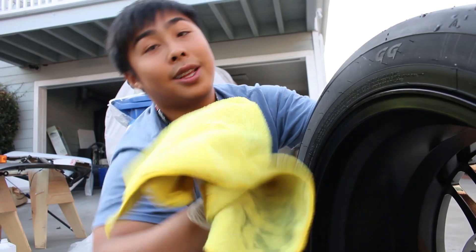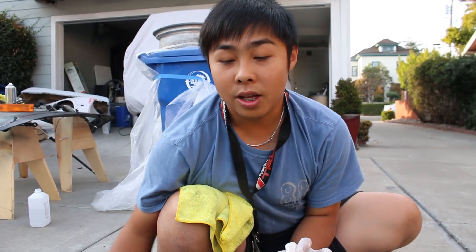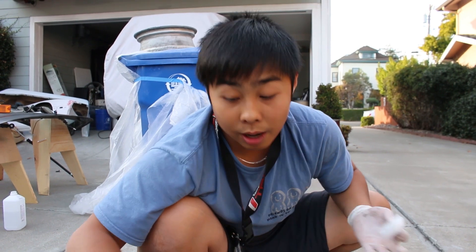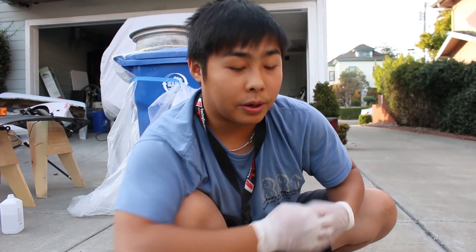The wheel is ceramic coated now, so don't get the wheels wet. I know it's tempting to immediately test how hydrophobic it is, but realistically you want to wait at least 24 hours. That's what I'm going to do — wait 24 hours before testing durability and hydrophobicity. We're going to cue the cinematics and do the other three wheels the same way.